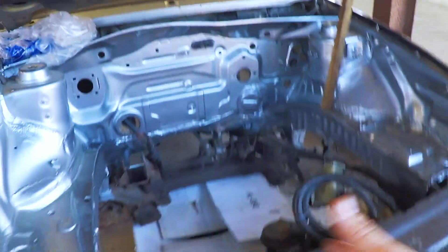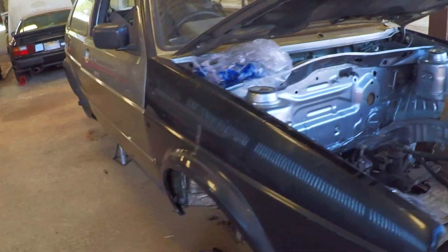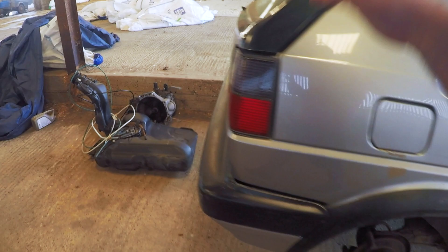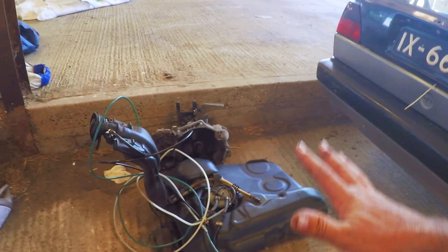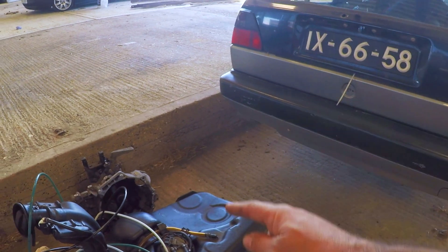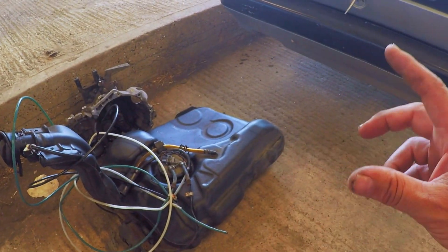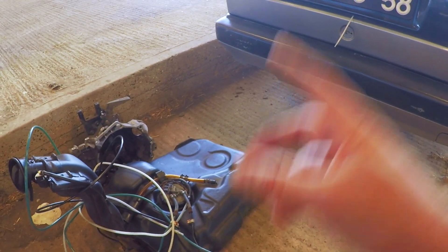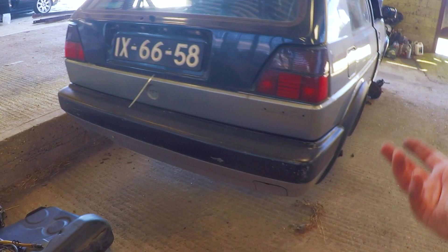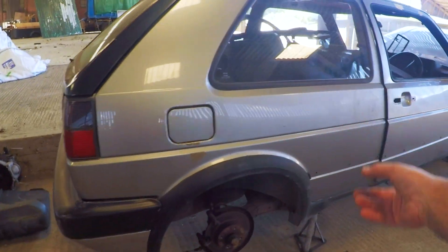That's the base we build from. To go with the engine conversion, we have a Mark 3 fuel tank here with the straps — it's a 16-valve one. We'll fit a Walbro pump in it because even on a 16-valve setup the stock pump isn't good enough for the power figures we're aiming for. So we've got a Walbro to drop in there with the straps, change all the fuel lines, and ditch the Mark 2 dual-pump setup on this GTI.